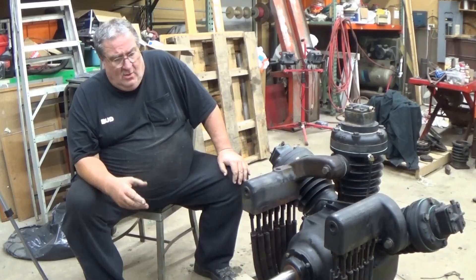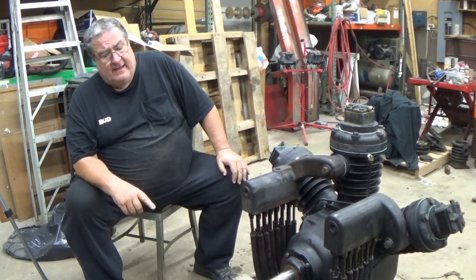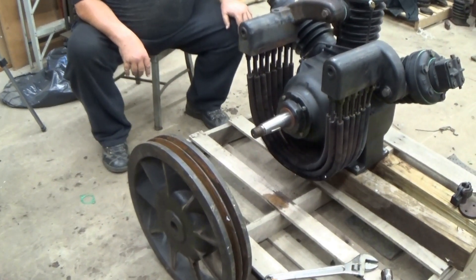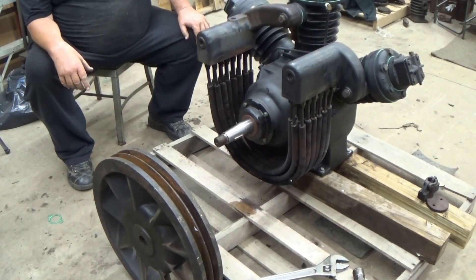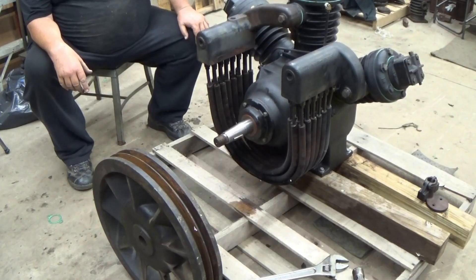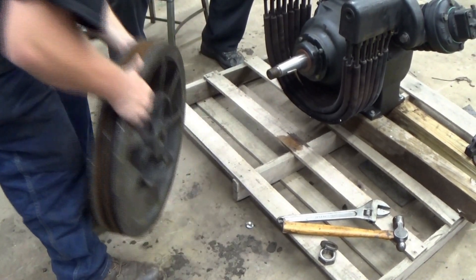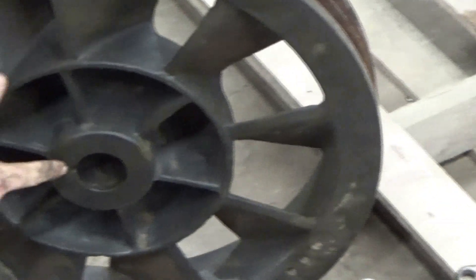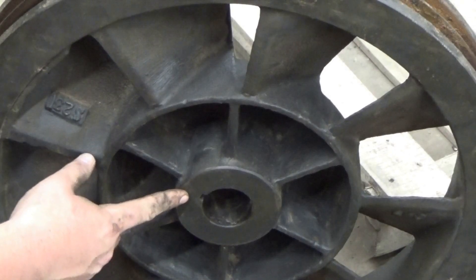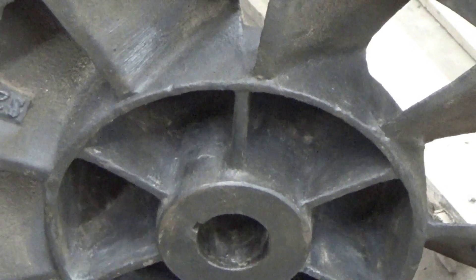Now that we have our seal on, we're going to have Scott lift this flywheel — this heavy, rotten, heavy flywheel — up into place. Off camera, I put the half-moon key into the crankshaft and tapped it in place. This is a tapered shaft, so Scott's not going to have to grunt — all he has to do is line that key up and push it on, and we'll tighten it with a big nut. There's a slot in the flywheel — show her the slot. So it has that little tiny slot, and that goes to the half-moon key. Even though it's tightened up with the nut, that will keep it from spinning on the shaft.